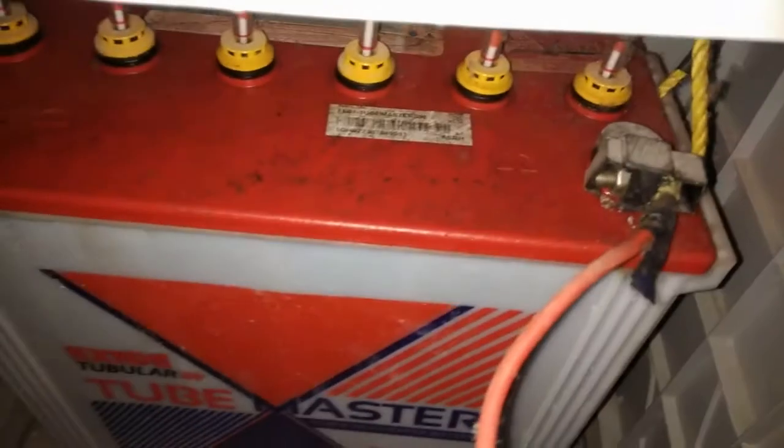There is another way to charge your battery: if you have an inverter or a UPS at home, you can use that to charge the bike battery. But make sure the inverter is charging a 12-volt battery unit — not anything higher — else you might damage the bike battery. Again, this is an expert-level DIY attempt, only if you are confident you want to do it.